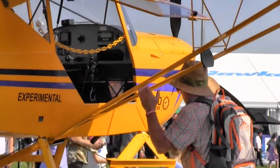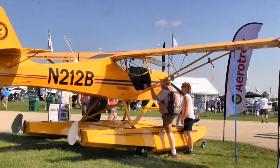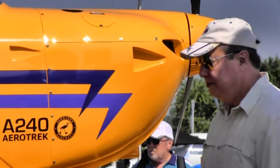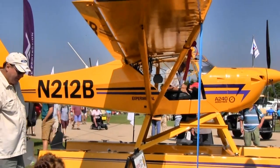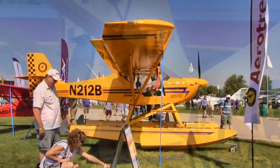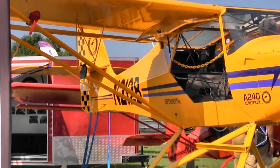The 914 is actually an 80-horsepower engine with a turbo boost — a wonderful 80-horsepower base engine that performs very well. We do have several airplanes flying with the 80-horsepower engine, but in the early years when there was a small price difference, pretty soon everyone was going with the 100-horsepower engine. It's been standard with the 100-horsepower engine for about the last 12 years.